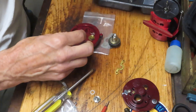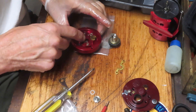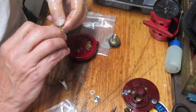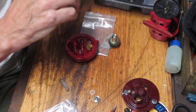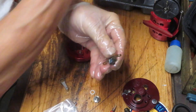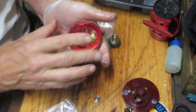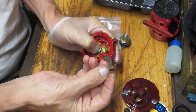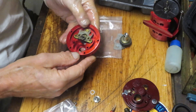To continue, take the yoke springs and bring these in. Get the bearing for the side case — this is the second bearing — that seats in the back end of the case. Once you clean your yoke, put some grease on it. You can get both sides because there's a groove for your pinion gear. Check your pinion gear — I checked this one earlier, it's in good condition, so just grease it up. Install the yoke over the two springs in the side case. When you push down on that, take your jack, hook it around the top, and make sure that stud is in the little groove in the jack. That's the jack assembly.